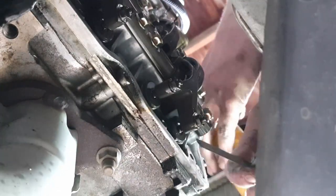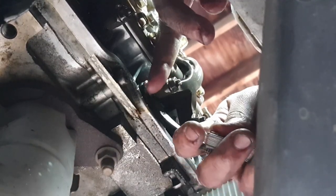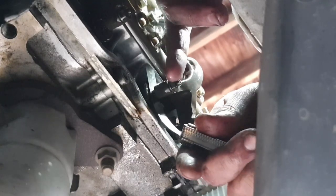So I'm going to go ahead and drop my light. It's a big mess. So again, I'm going to get the feeler gauge in there. There we go. I'm going to run down that screw a little bit so it's just beginning to pinch on the feeler gauge. And I can feel it binding. It's sort of resisting me pulling it out, and it's sort of chattering on the way back in.